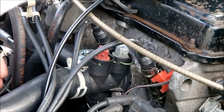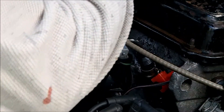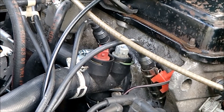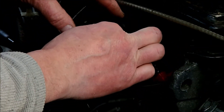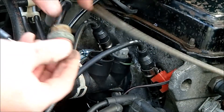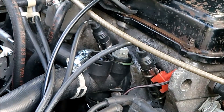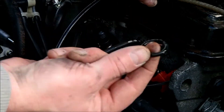I'm going to attempt to remove one of these clips without breaking anything. I don't know if it's going to come out easily or with difficulty. Oh, that seems ridiculously easy — that's one metal clip. And hopefully we've removed enough coolant now to allow this to come out without spilling. Yes, that worked. There should be a rubber o-ring in there as well — here we go, one rubber o-ring.